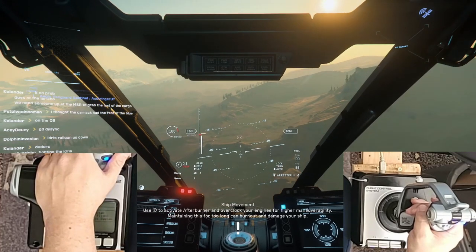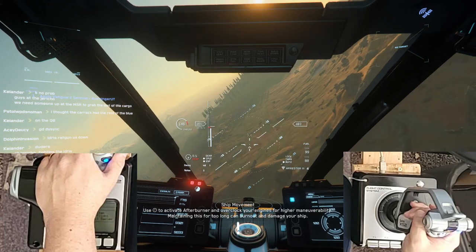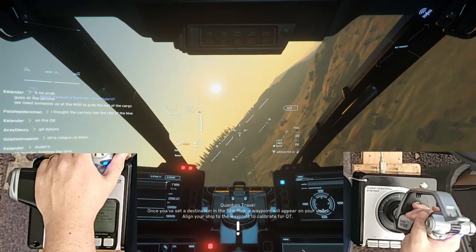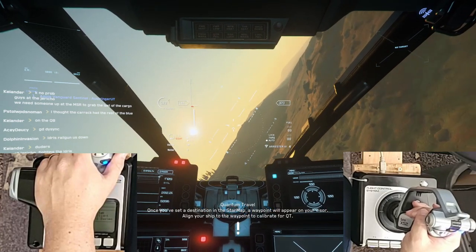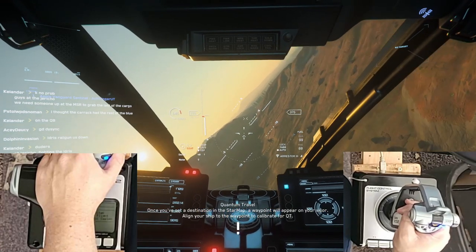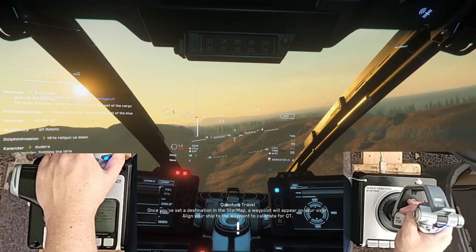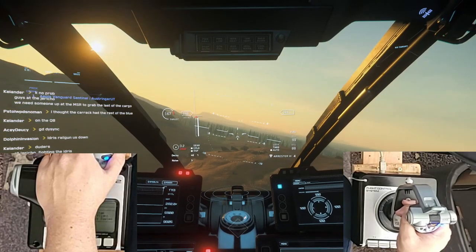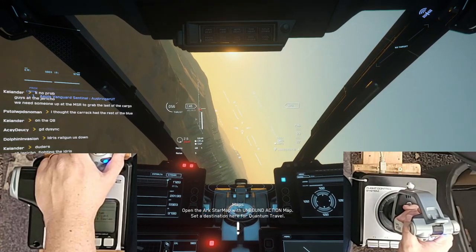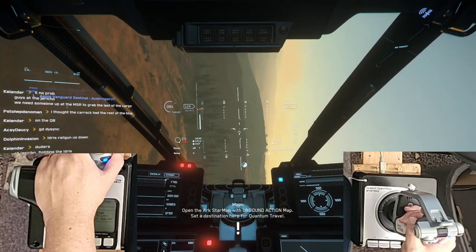The X and Y axis are very loose and very twitchy in the center. There's a ton of slop in the center of the stick. As I mentioned before, the Z-axis is actually the best axis in terms of translation of movement into the movement of your ship. The gimbal itself has a lot of drag, and does not smoothly operate. This is actually a problem with this gimbal type, and it's inevitable for it to wear rough spots in the ring or plate and become sticky. I've sanded and lubricated this stick, and it all just comes back and gets rough again.